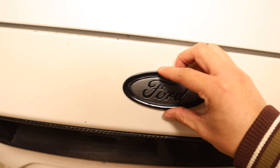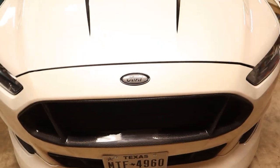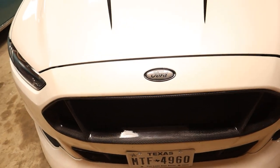For the easy part - putting it back on the car. I've got this 3M automotive tape and all you do is position it, press it in, and you're good to go. As for the bumper, it's basically doing everything in reverse. It does help to start with the upper half underneath the hood to secure it so it doesn't move around. Putting it back on is actually easier than taking it off. It has the prongs for a reason - just sink them in there. I went for a subtly different color tone - the ring in the back is painted metallic gray and this one I painted black to emphasize the gray itself.